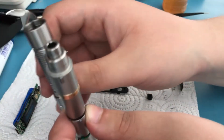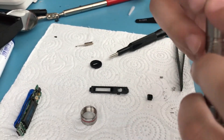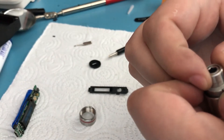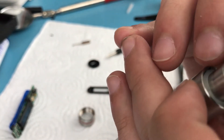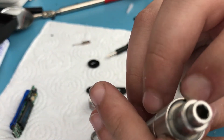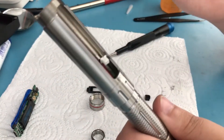This is basically the entire assembly of the mechanical parts. Now grab the main body and carefully drop it into place. You want it to slide in properly without dropping any of the steel side pieces, while also aligning those steel side pieces with their grooves. You need to align the motor properly too, otherwise you won't get the thread lined up with the brass piece. Just rotate the motor until everything aligns.